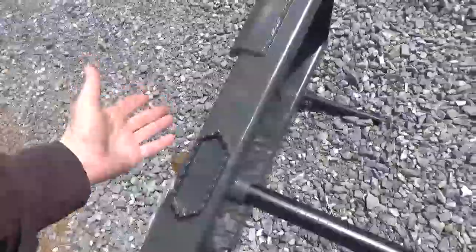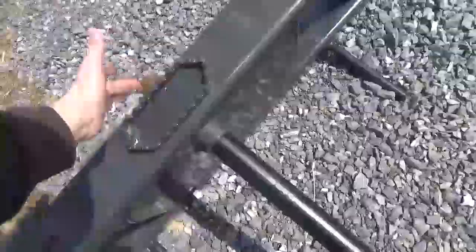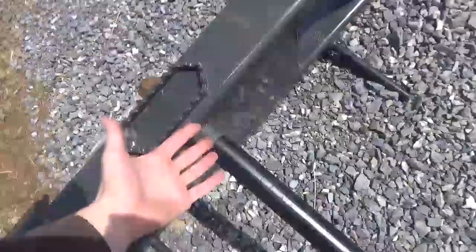So in the low back single spear configuration, this is exactly what it's going to look like. It's going to have the 2 little side spears down here, and then your single center spear. Spear length overall is 48 inches, and then protruded length is about 42, okay? So you've got your cheap ones out there running around where they just use a little collar up here and 2 little pieces of flat steel, and they weld it to a box tubing, and that's it. Well, CID uses a roll formed center here basically to double gusset everything, and then this is a solid steel collar, which I keep in stock here if anybody ever needs them.